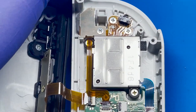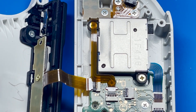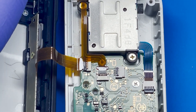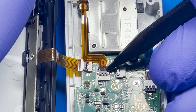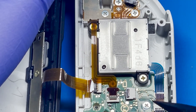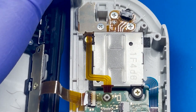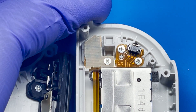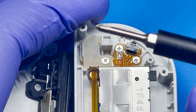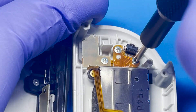The only thing we're going to need at this point is a spudger. We're going to need to remove this ribbon right here — you have this little latch and we're just going to flip this up and that should free it up. There we go. Once that's removed we can go ahead and get that out of the way. The next step is to remove these three screws. These are being held down by 00 Phillips screws, so I have a 00 bit here and we're simply going to remove these — they're the ones that hold down that button.